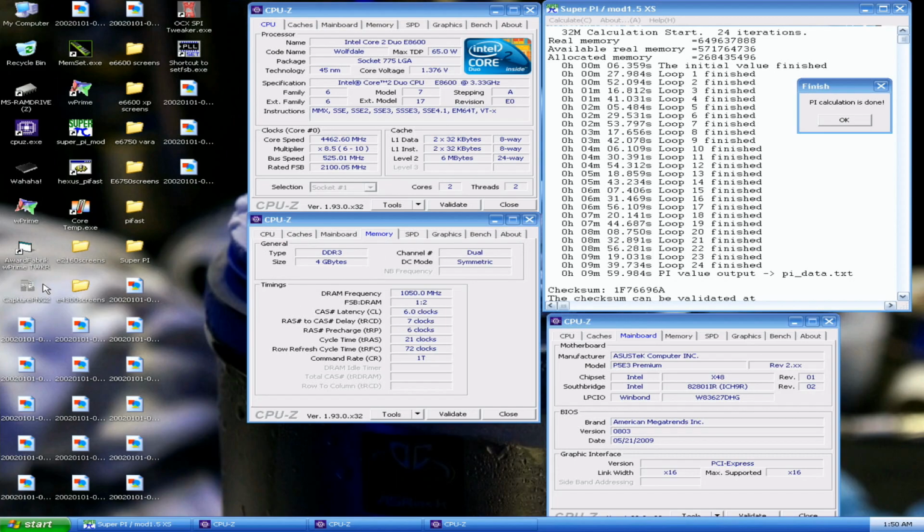Based on what I have discussed with a few other members, many people consider 2100 plus with performance level 6 a good target. So performance level 5 is much harder to achieve than performance level 6. So I'm quite happy, and you don't really need much higher frequency than this, because as I already said, the key factor after this is whether it can still run very good memories in SuperPi 32M when the FSB is much higher, like 600 plus. So you don't really need more than 2150 memory wise, even with something like performance level 6. So this is definitely a very good result and probably good enough already. Let's see what the max is with performance level 6.